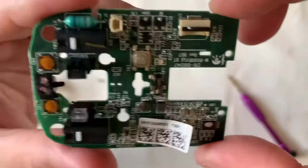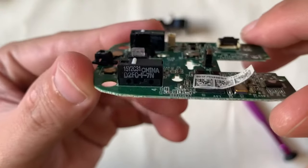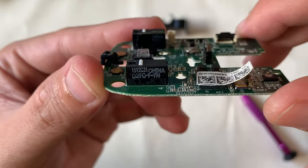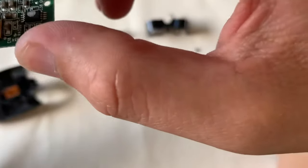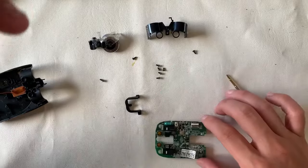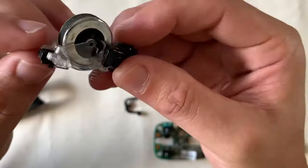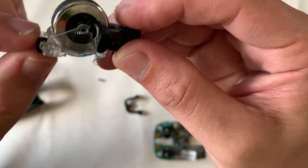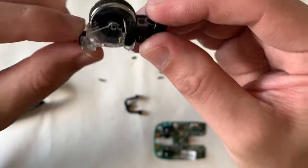There's a sticker here that we'll rip off later. There's also a plastic part that holds the mouse switches — this is for your reference in case you need to change them. Most switches are interchangeable; just make sure it's a 2-pin or 3-pin to solder on. This part slides on, and inside is a small black piece that's unlikely to drop out because it's filled with some grease.